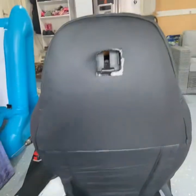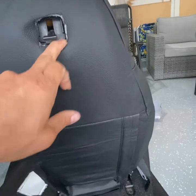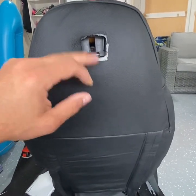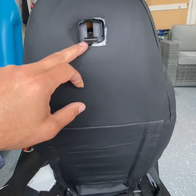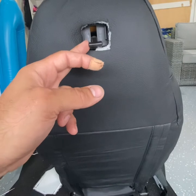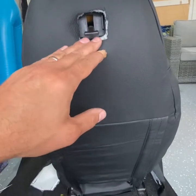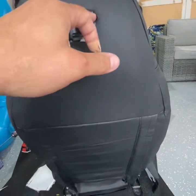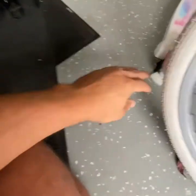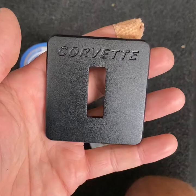The first incision is made - that's the main important one, and this is the one I screwed up. I'm going to test fit the bezel first but I might have to trim a little more. Basically when everything is stretched out you make your incision right under the lever itself - about a quarter inch out from the edge of the lever, and about an inch and a half vertical. The leather will sag a quarter inch on each side. About an inch and a half top. You can trim as needed. When I first did this I overcut up top and that's why I had to get a custom-made bezel.